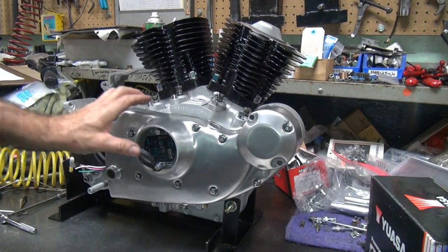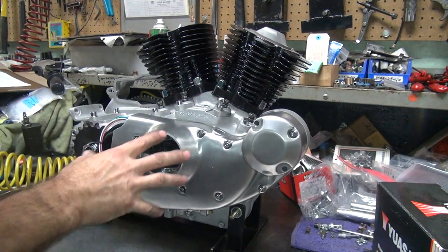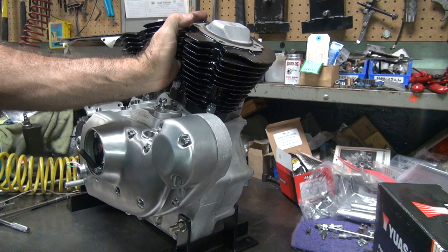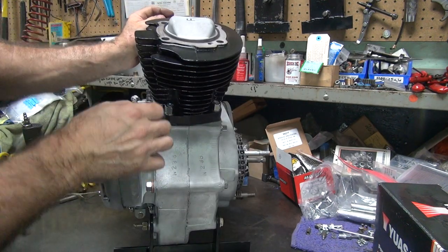Okay, now we're going to have to make our timing work. So remember, this module only goes to 34 degrees timing, as out of the box. This motor wants 45 degrees timing, it comes with 39 degrees. So we're short 5, and 11 more would be nice.